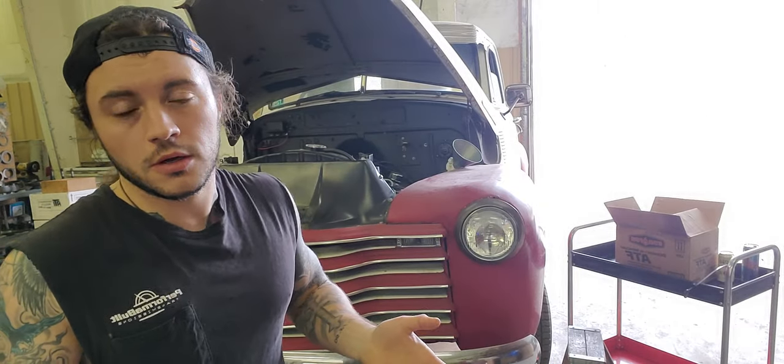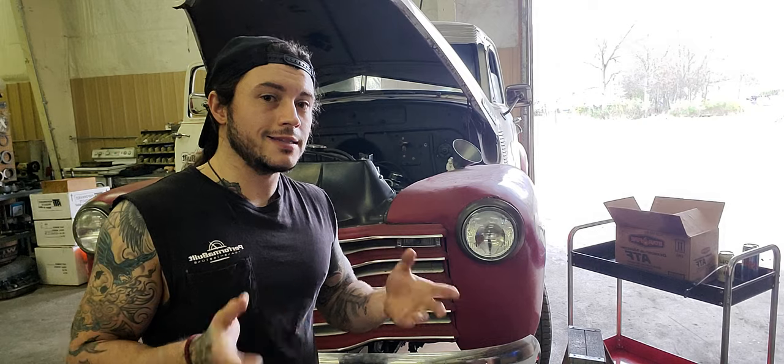Reverse is pretty much the entire servo assembly applied for the band. The clutch is in the reverse input drum, which is a very large piston, and the low reverse clutch is in the very back of the case, which is a huge piston. It's about the size of your average cereal bowl. That's a lot of fluid.